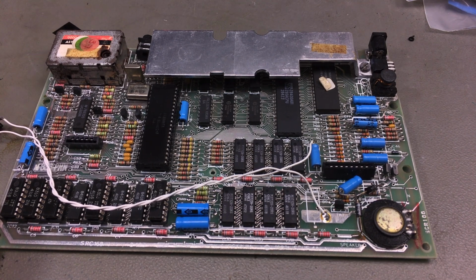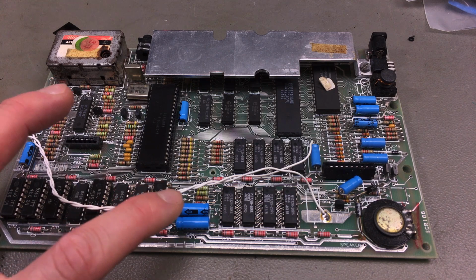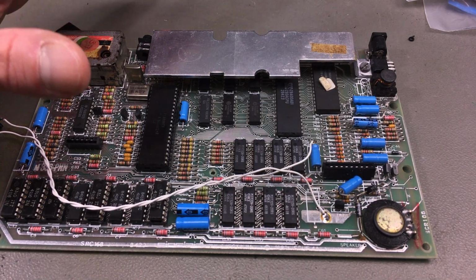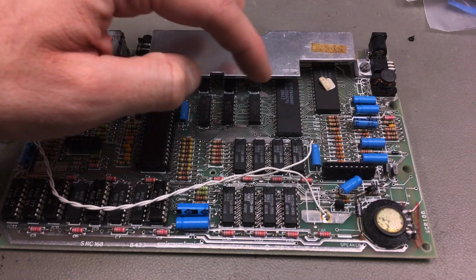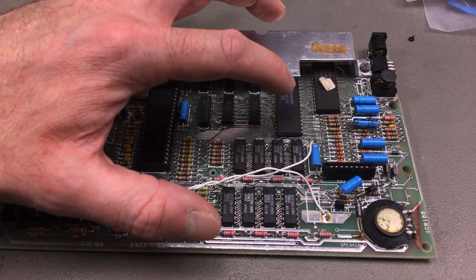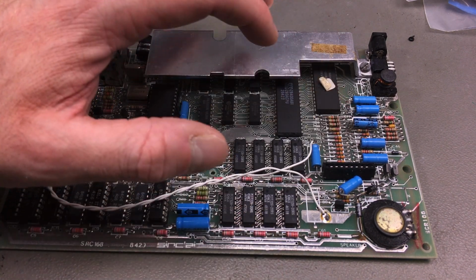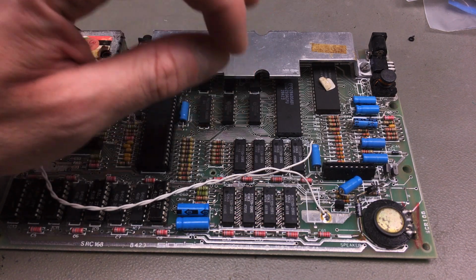And I think we're mostly going to use 1 microfarad ones. These are 100, I think, and some 22 microfarad ones. You always want to go the exact capacitance. That means a 1 microfarad cap should be replaced with a 1 microfarad cap. And for the voltage, you can go slightly higher or stay the same, I would suggest.